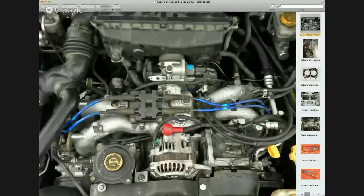So let me share an image. That's a top view of a Subaru engine, around a 2000 model year Forester, 2.5 litre engine. The intake manifold runs along the top, those nice bright blue things are your spark plug wires. The alternator sits in the front, the wire to the alternator has got that nice bright red cap on it. So that's basically the top of the engine. Now the head gaskets are down lower, kind of where those blue wires lead off to the sides — those go towards the cylinder heads.